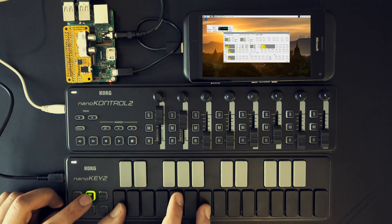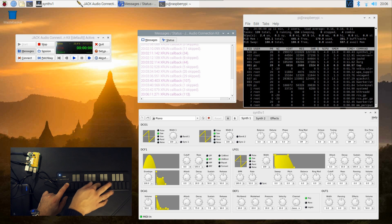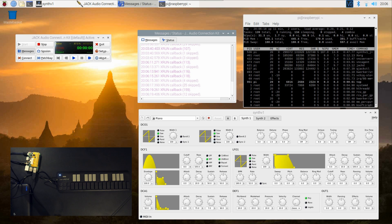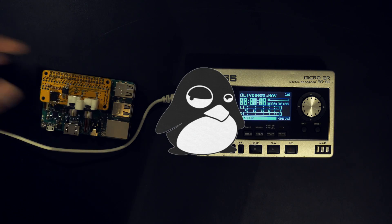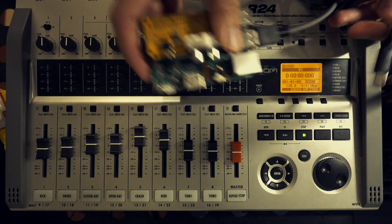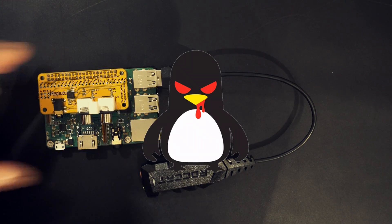But while I was playing around with this synth, I noticed some weird audio glitches, which was strange because the CPU still had a lot of headroom. Jack's log showed some errors named X-Run Callback. A quick search on the internet suggested that the Pi's internal sound card can't handle all the stuff going on, and that installing an external USB audio interface is a solution. Any standards-compliant interface should work, they said. So I tried my bus recorder — Linux said no. I tried the Zoom R24 — Linux said no. I bought a cheap USB audio stick from the compatibility list — Linux said no. And I was like, fine, okay.